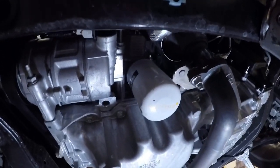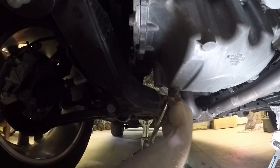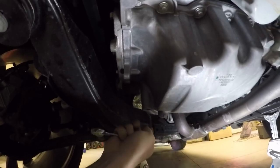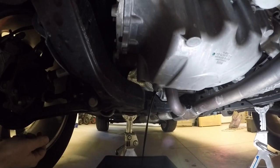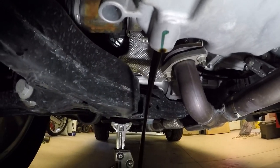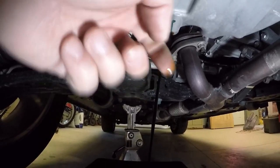There's your oil filter and it's very easy to get to. I'll pull the drain plug out — this is a 15 millimeter wrench. It sounds like they put a rubber seal on there. I just drove home so the oil is really hot and I'm going to be careful. The oil already looks relatively dark, but not too terribly bad. I can't believe after 10,000 miles it wouldn't look like tar.